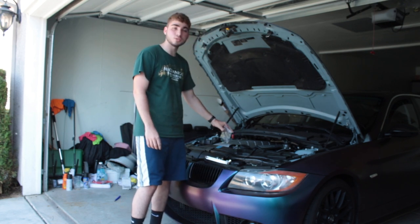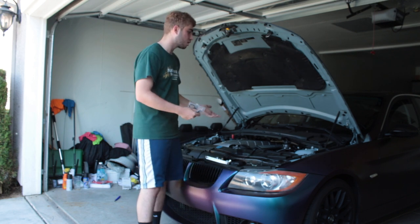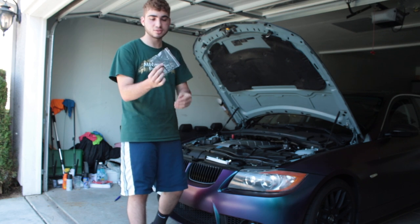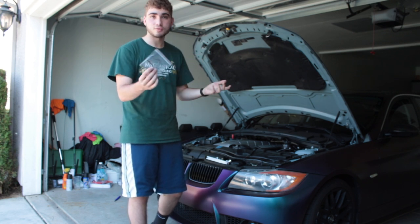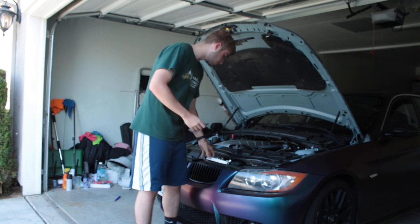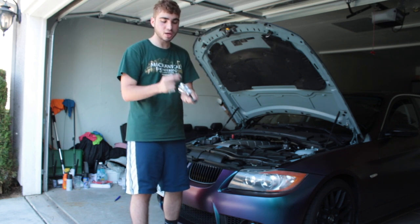This was one of the many leaks that happened after my engine overheated. This is mostly caused when your water pump goes out and all the heat ends up blowing this little gasket. So, just a few tools that you need. You need this gasket right off the bat. Link's going to be in the description. I got this for like 12, 15 bucks. And then you need, I think, an 8 millimeter swivel socket.